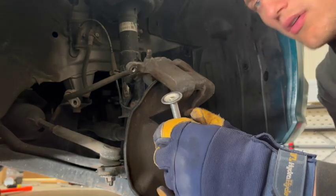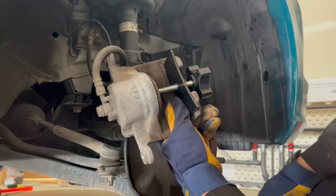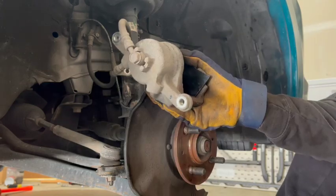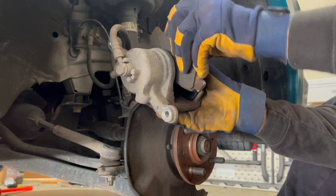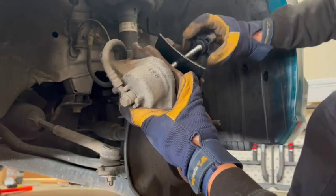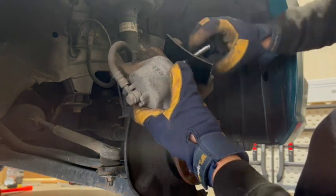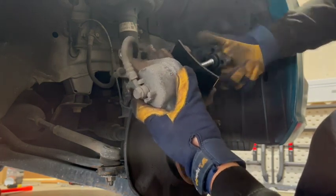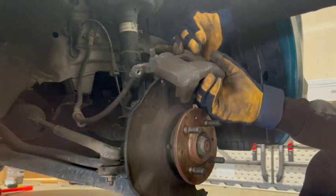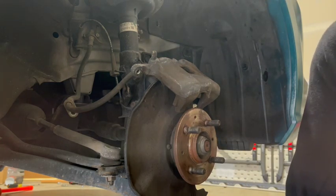Now, I didn't show you this on the other side, but they make a little expander for your piston. It helps to expand the caliper and push it back in to make space for your new pads. I have no idea what it's called, so there is no link in the description below. But if it's not working, you can just shove a brake pad in there and use pretty much anything to push that back. You just don't want to go really, really fast. You'll monkey with it a lot, but the point is just to get the piston flush. Once you're done, put the caliper back out of the way until you can get the rotor back on.